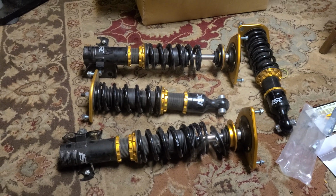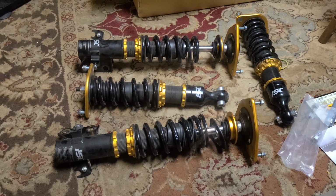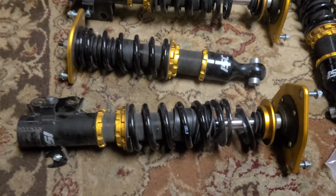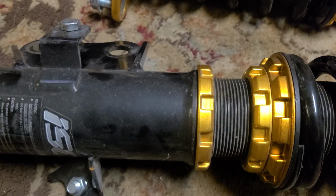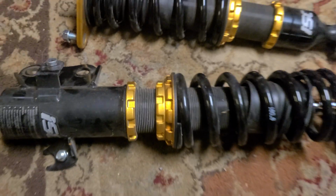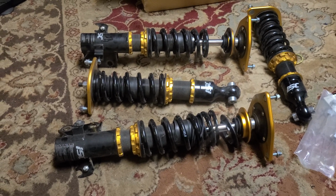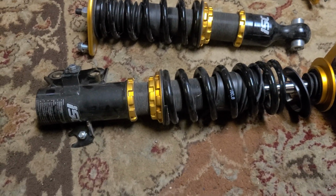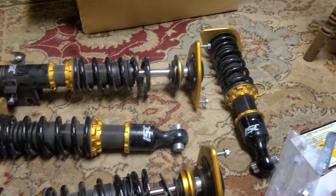That's just a quick rundown on how to get this set up. And hopefully, if you aren't experienced with how to set up coilovers, if you buy used coilovers and they're not set up properly, hopefully this sheds some light on exactly what you should do. And again, this only really applies to a setup like this where there's a collar on the bottom that meets the actual bottom mounting section of the coilover, in addition to the 2 that you would find on any coilover. This is generally how a lot of coilovers are set up nowadays. Obviously they're going to look a little bit different depending on what car they're going on, but overall this is a pretty much universal process and should apply to just about any decent, middle of the road or better coilover that you might get.